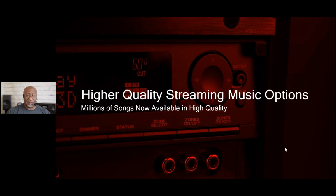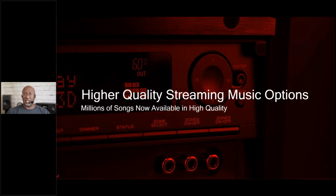Take it away. But let's talk for this last 20 minutes about just tips for setup. Now, we had already mentioned that I have 15 zones in my house, and I'm running a lot of those zones in their highest quality. So everything is being played back at least at CD quality. Some of the services like Amazon Music in the US, we can do 192/24 FLAC files as part of that. So we know that as you add more zones and those zones are at higher quality, it's going to put a bigger load on your network. So let's talk about tips to ensure that you have reliable service throughout your entire home.